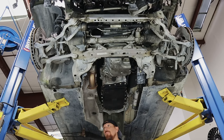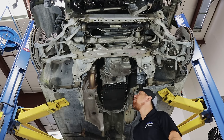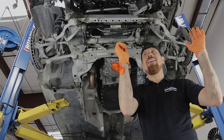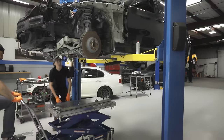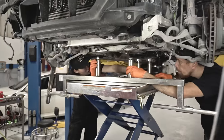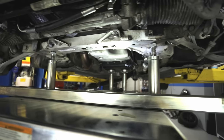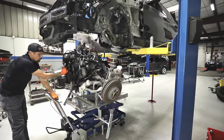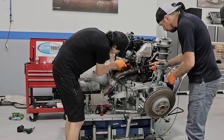I'm sure we forgot something — we'll figure it out when we drop it. Joey is fetching the engine table. I love this thing — it has all these really cool attachments and features, jacks way high up in the air, and it's very secure. When you pull the engine, transmission, and subframe down altogether, it's just properly done. When you pull the whole front of the car out, the rear is heavy, so we put a pole jack at the back of the car underneath the differential to prevent the car from falling off the lift.